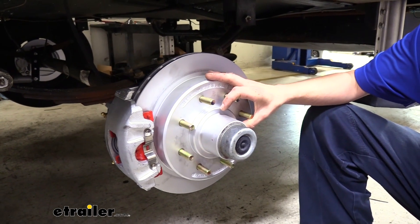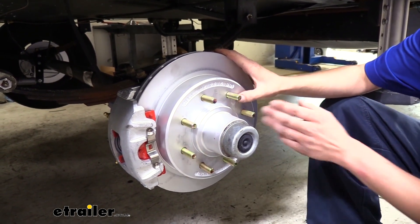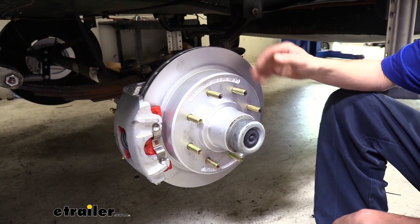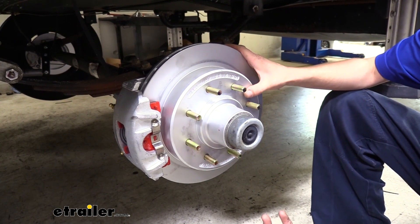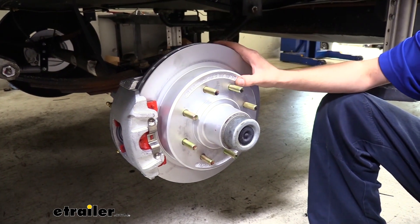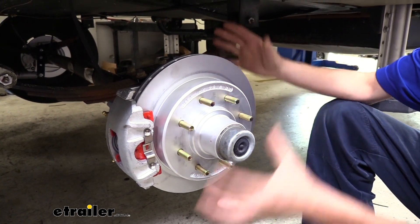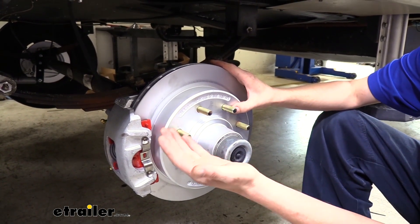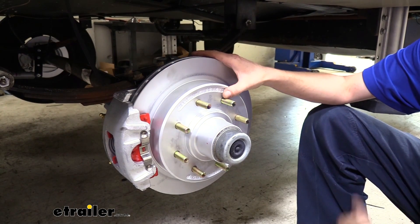This is what your disc brakes look like when they're installed. These are a replacement for your existing drum assemblies, or if you already had disc brakes you can use these as well. They're designed for 7,000 pound axles and have an eight on six and a half bolt pattern. Upgrading from drum brakes to disc brakes gives you smoother brake operation and decreased stopping distance because you have more surface area to grab onto. Since this is a hydraulic system, the actuator proportionally applies the brakes so it's evenly distributed and very smooth — unlike electric brakes where braking happens instantly, this gradually brings them on so it feels more natural, just like driving your car.